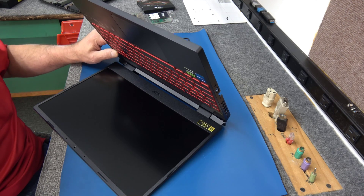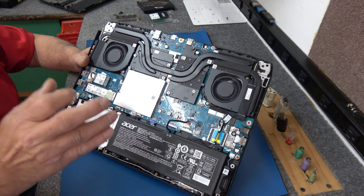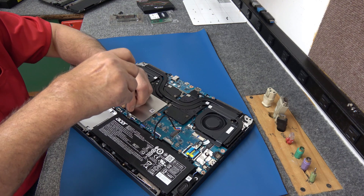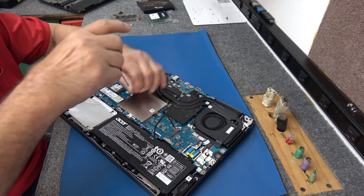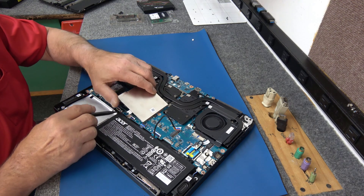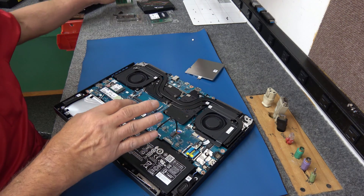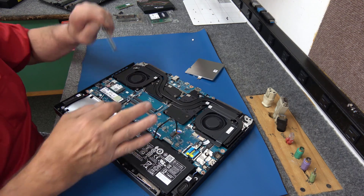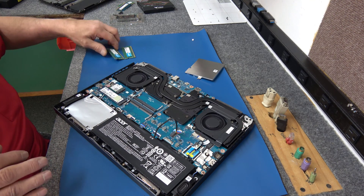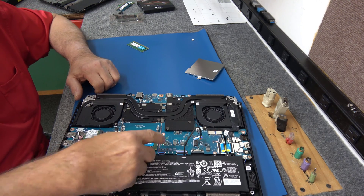You don't want to drop a screw or one of your tools onto that shield. There's one screw you have to take off to lift the shield off here. Let's do the RAM first — I'm just going to remove the shield here. Here are our two sticks of RAM — eight gig sticks. I'm going to pop those out and put in our set of Crucial, 3200 megahertz. Get a good click in there — just like that.